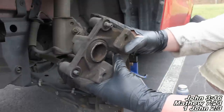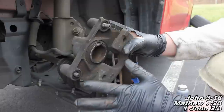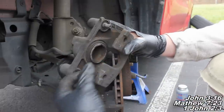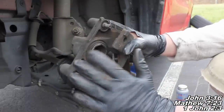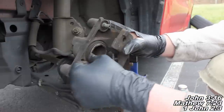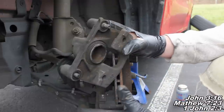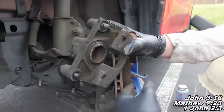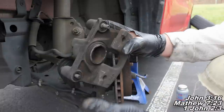The next thing you'll want to do is, if you didn't get your caliper piston compressed all the way back with that flathead screwdriver method, you can go ahead and take a C-clamp, stick your old pad in there and hook it up, and just twist it down until you can press it all the way flat. If you don't want to use the C-clamp method, you can also stick a new pad in here, set it back on your rotor, and use the flathead screwdriver method once again — you should be able to compress the piston all the way back doing it like that.